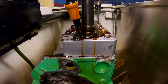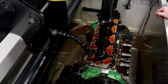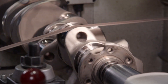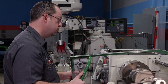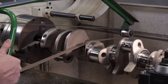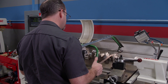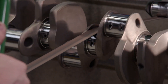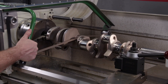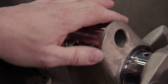The final bore size is 4.043 inches. A 41-degree crosshatch was introduced to promote good ring break-in. The crankshaft is a forged 4340 unit from Eagle. We ordered new pistons that were 26 grams lighter, so the crankshaft had to be sent out and rebalanced. It went to our favorite little machine shop in Nashville, Tennessee — Shacklett's Auto Machine. They did a great job adjusting the weight, and it shows their attention to detail.